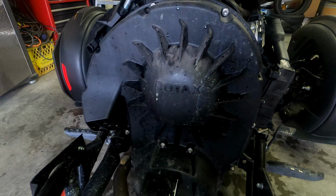We're going to pull this housing off. So there it is. Our next endeavor here is to pull the housing off of the clutch. Take that off, which is this thing. Need a 10mm wrench for that. If you're going to do this, make sure that this upper clam part is very secure. Propping it up with a 2x4, a lot of people do, but in our opinion, this is the better way to do it. We need clearance to get this off. So this little shield, he's already taken the bolt out, and then that needs to be removed.